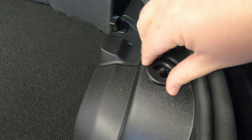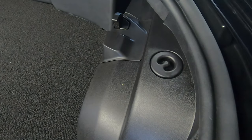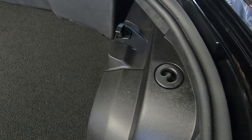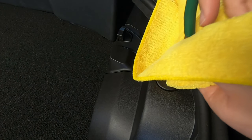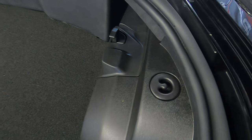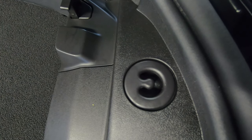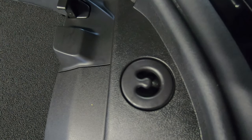To put the new one on, we're just going to snap it right down into place and then give it a quarter turn. Since this is the new one, we don't want to mark anything up, so I'm going to put my pair of pliers through a microfiber towel, squeeze around that piece, and turn it until you hear it pop into place. Now it's good to go. I'm glad GM made them easy to replace — they probably knew they were going to break a lot. The part number is down in the description below.